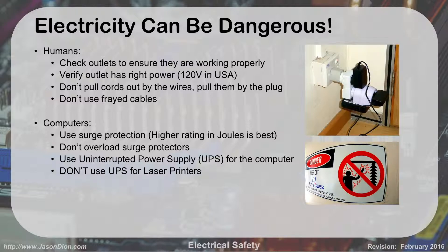The nice thing is that most of our computers have dual voltage ability on our power supplies. It's either a switch that you flip to tell it what the input is — and we'll cover that in power supplies — or they're auto-sensing where they'll adjust automatically. Laptops are all auto-sensing, so you can plug into any outlet and it'll work between 120 and 240 just fine.